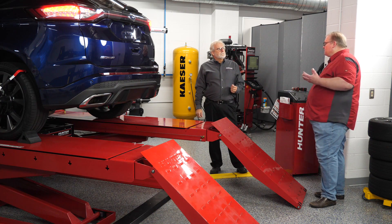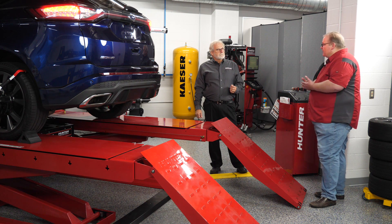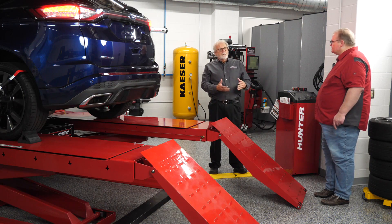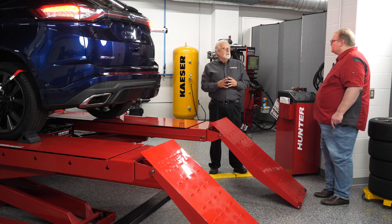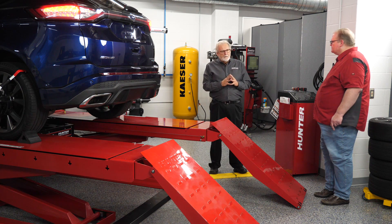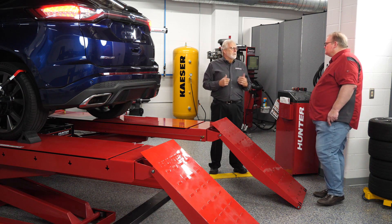For the customer, once you perform these procedures on their vehicle, what can be presented to the customer to say, this is what we did on your car, this is what we calibrated, here's some new technology? The ones that we can currently reset, that's going to be put on the printout, so it'll tell me sometimes before information and after, or that it was completed successfully, so it's documented that way. If they use a different scan tool, that can also usually be sent to a printer too. We highly recommend on any kind of vehicle equipped with ADAS that you do document the calibrations.